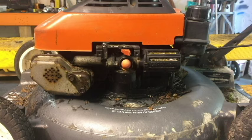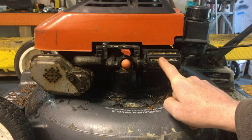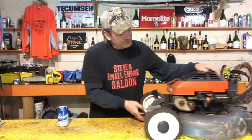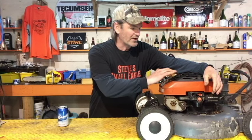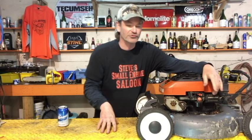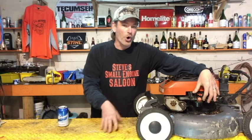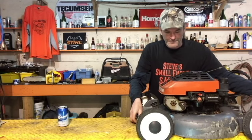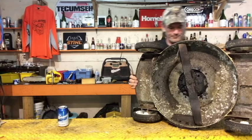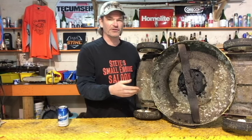There is also a wrong way and a right way to flip the lawnmower over. Verify where your carburetor and air filter are. If you flip it so the carburetor and air filter are on the downside, gravity is going to run all your engine oil right out through the carburetor and air filter — oil all over the ground. Always keep the carburetor and air filter on the upside when you flip it over.